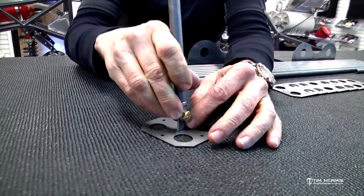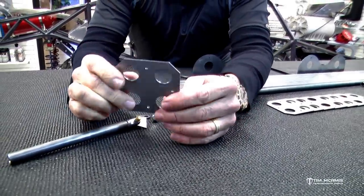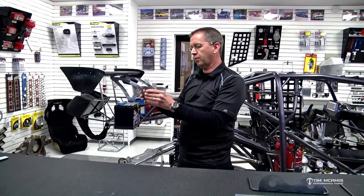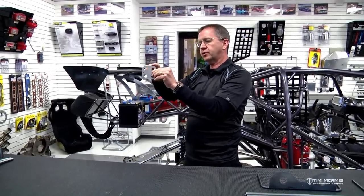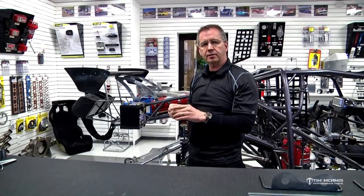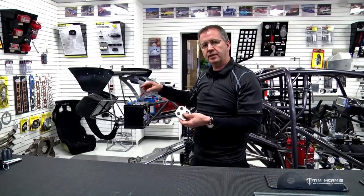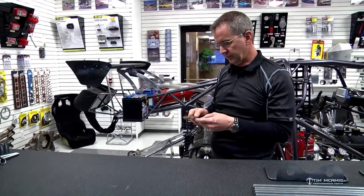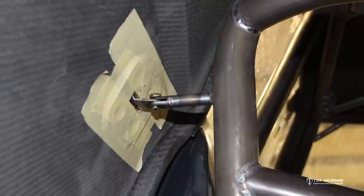We're going to weld this tab onto this plate in advance and get that grinding all done and make sure that the back of it's smooth. And then when we're ready to mount it, instead of drilling holes in the outside of the body, we're going to make a few marks inside that body and tape these in place — put them up in there with two inch tape down each side, get them where you want them, get them lined up, get them all straight. Then you can just scribe around that plate once you've got a location for all three of them and pull them out. Go ahead and grind the back side of this, rough it up with like some 30 grit — give it a nice rough finish. Do the same thing on the inside of the body, abrade that inside of that carbon or fiberglass body. Use some structural epoxy — we have it available on our website, it's a two-part structural epoxy. Put some epoxy on the back of this thing, stick it in place where you've scribed it, put a couple pieces of tape on it and let that stuff kick off.